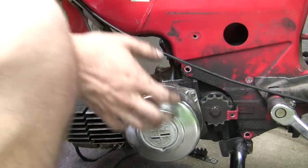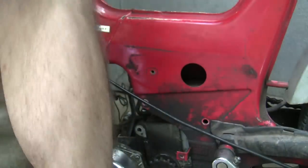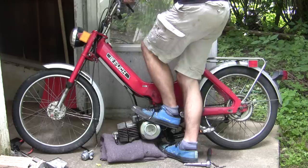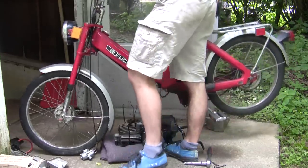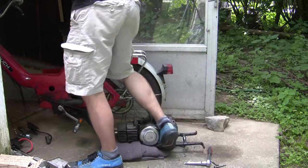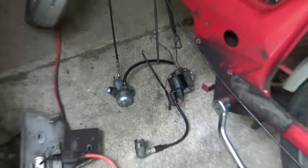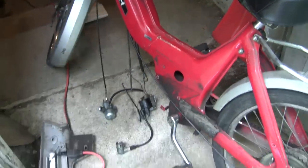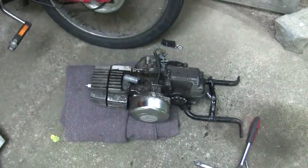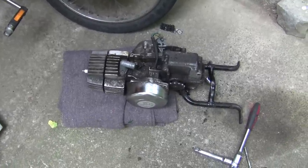There's your engine. Lift back up on the frame and it kind of slides forward. Be mindful of all your bits that are hanging down. The spark plug boot comes off too — should have mentioned that earlier. Be mindful of all the danglies. If you want, you can take the top off the carburetor and the electronics off right there, but I'm probably just going to take all those cables and duct tape them up on the side of the frame. Anyway, that's how you get an engine off of a Puch Maxi — the E50 anyway. If you have the two-speed ZA50, there are a couple of things that are a little bit different, like the clutch cables. But that's what I have to show you today — hope you enjoyed the video.